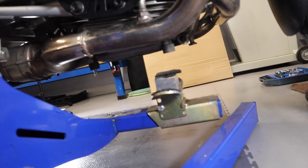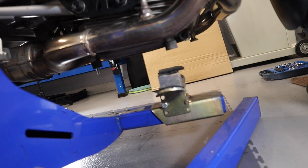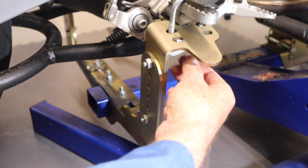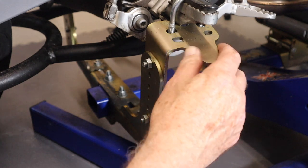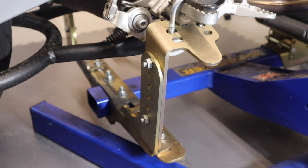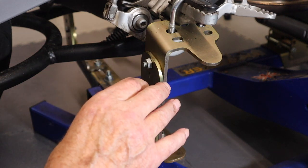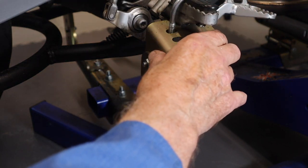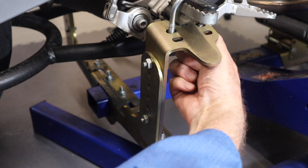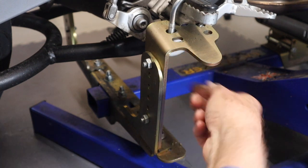This is where it's a little bit of a fiddle, but once you know what you're doing and if you have the same bike, you can always set it up. You can see what I'm doing — I'm putting this U-bolt on. I've adjusted these, which will go in every direction. It really is like a Swiss Army knife — slots everywhere so you can adjust them to fit your bike. I've got it under the foot peg, then the U-bolt goes on with wing nuts, and I screw it right up as tight as I can, so it's locked on the back foot pegs. I do the same on the other side.